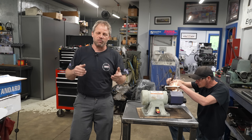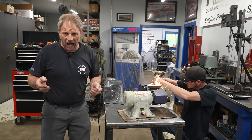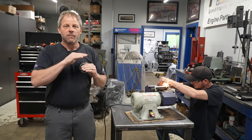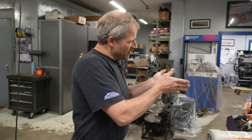There are lots of questions out there - why are you putting so much time and effort into this small block? Well, I don't want it to come apart and the devil is in the details. I like to go through and balance it for the price of a balance. The factory rods are within 14 grams, and that's a lot - that's a big spread. We want them down to basically exactly the same. Motor runs smoother, motor will not hammer out the bearings over time.